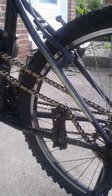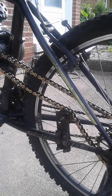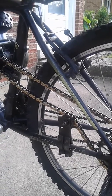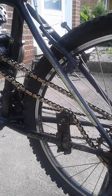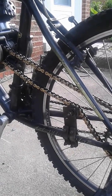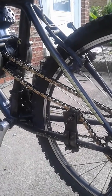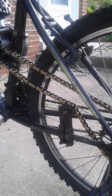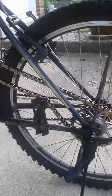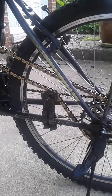The Regina 415 chain is nice and strong — I highly recommend it. For all you guys having chain issues, get a name brand 415 chain. Don't get the 41 chain or the 415H. You want a chain that sits right on the sprockets, otherwise it will wear your sprockets out quickly. I also just got this new rear wheel — it's an Alex rim with an 8/9/10 speed free hub.